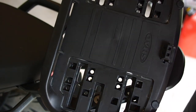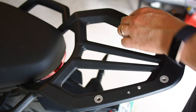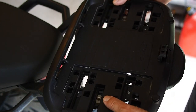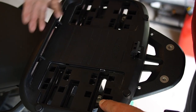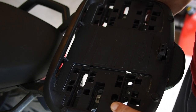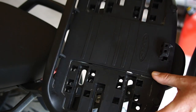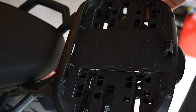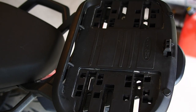You can see these holes — I ended up choosing the middle ones from this first set of holes because I didn't want the box sticking way off the bike. If I'd used the farther ones, you wouldn't be able to take the seat off. So those middle ones are what I went with personally. There's also another set of tracks here that I was going to use — I had bought some bolts and was going to put a quarter-20 bolt in there.